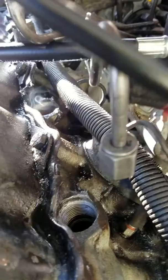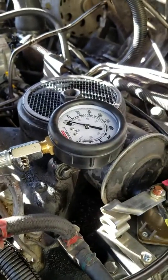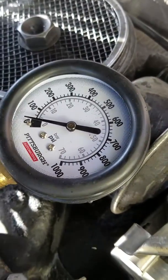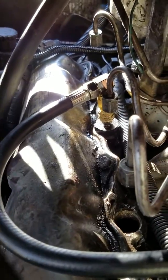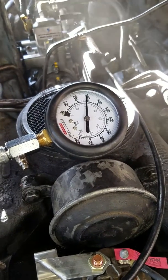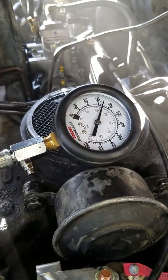We're going to see fuel coming out the fuel lines — yeah, the glow plugs. Nothing on number one. Alright, so we're moving on to the next cylinder on this side. Number one was dead. Let's see what we got in the cylinder. We got a difference — so definitely number one is dead.